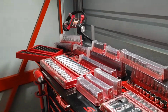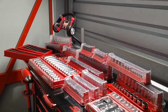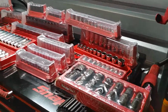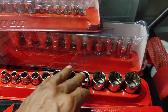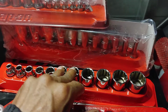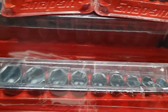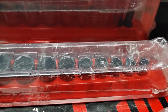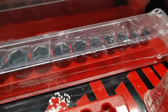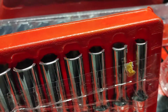One last thing that I want to point out for your younger technicians out there, because I want y'all to get an understanding, just as well as some of the individuals who may not have a mechanical background. When you take a look at these chrome sockets here, which are SAE standard, these are 12-point SAE standard sockets, but these sockets also come in 6-point metric. So your 6-point metric would look like this. These SAE standard impact sockets are 6-point. When you take a look at this SAE standard set in the chromes, this is 12-point. So there's a difference.